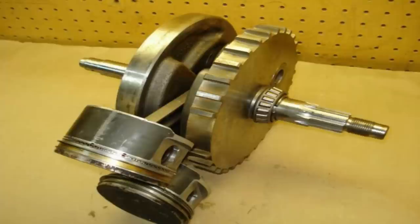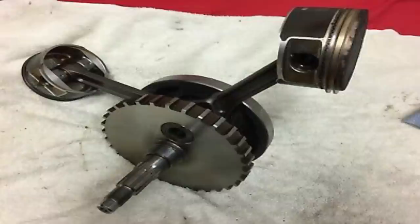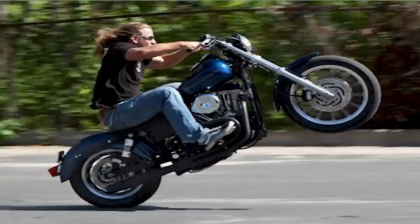The unique thing about the twin cam 88 is it was the only twin cam engine that used the short four-inch stroke. The 96 and 103 were later upgraded to a 4.375-inch stroke. That four-inch stroke really has its place — it's what makes upgrading an 88 to a 95 one of the most cost-effective and beneficial upgrades you can do to the motor. It is relatively inexpensive, and with the short stroke, the engine revs a lot faster, so the power and torque come on quicker and make the bike a lot of fun to ride.